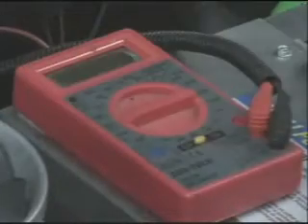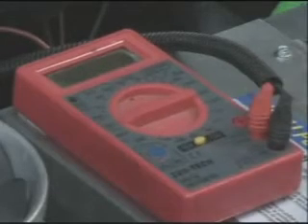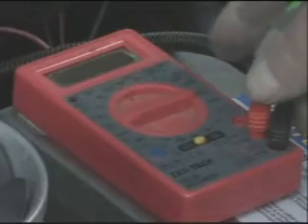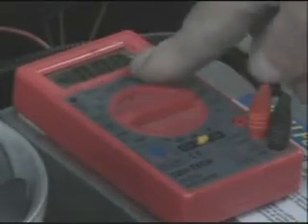You'll see a big long black tube across the front — that's a vacuum tube. And that red thing is a little monitor that tells you how much charge you're putting into the charger. When you're charging and you don't want to blow the circuit breaker, that will tell you — you can go up to 15 amps; if you go to 16, it blows, so you back it off to 15. It's just a little $5 item out of a catalog, but it's very necessary when you're charging your car.